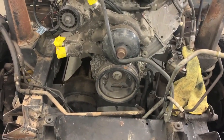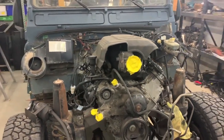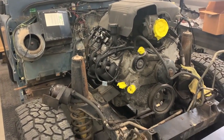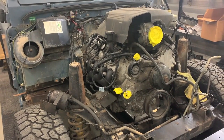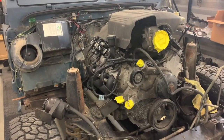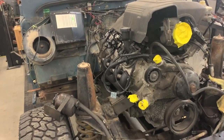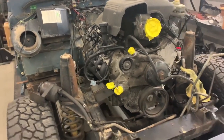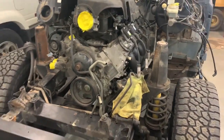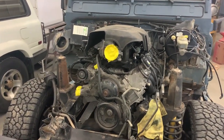We're hoping to do a mechanical fan, but we're still in mock-up stages — we'll have to get everything tacked in place and fitted to see where it's at. The transfer case is scooted back about 2 and a quarter inches from the factory location, which should in theory give us enough room for a mechanical fan. It also allowed for the shift linkage to come up through the appropriate hole. If you guys enjoy these videos and want to see more, please like and subscribe. Thanks for watching.